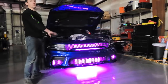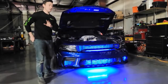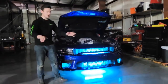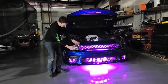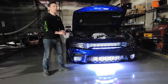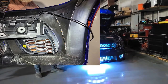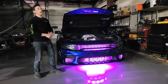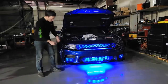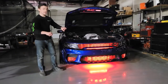Once you have that grill off, that's when you can really make your placements. Once we had the grill on the floor we put all our strips on and ran all of our wiring right here to the corner. Anytime you're putting strips on something that is removable, you do need to put on a quick disconnect — that way if you ever take your car in for service, they can get that grill or fairing off safely without damaging the lights. We ran all of our wiring right to here, made our connections for a quick disconnect, and then it runs up to where our controller module is mounted.